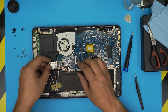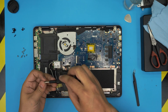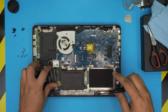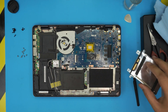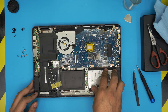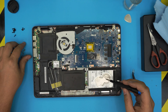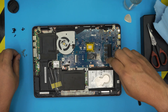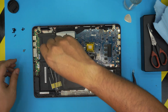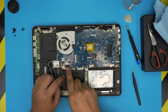Make sure everything is seated nicely. Put the Wi-Fi connector in and slide it all the way in, then put the screw for the Wi-Fi board. Bring the hard drive down, slide it in at a 45-degree angle all the way toward the jack, and put in the six screws. Put the four screws for the battery as well — note that the hard drive and battery screws are the same. Grab the battery connector, align it on top of the jack, and push it in.